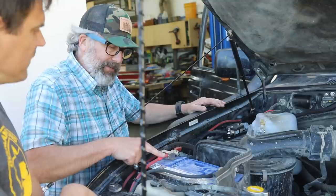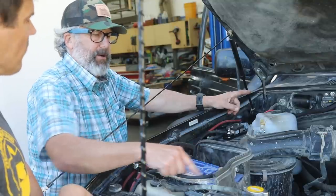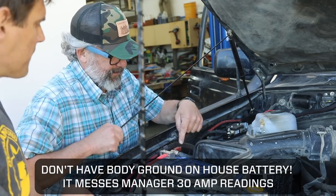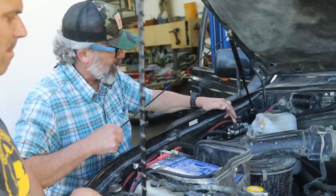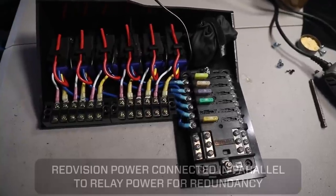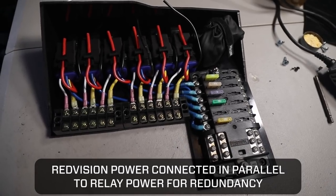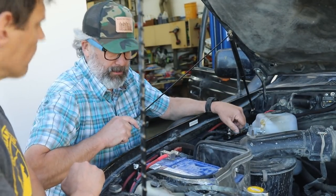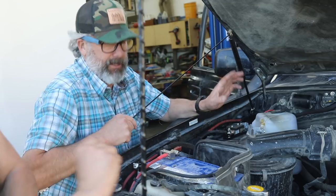So basically, we have a wire that leaves here and goes directly back to the RedArc system underneath the console, and a ground that goes directly from here back to the RedArc system. We also have a chassis ground here — which is overkill. Then we have a sensor wire that senses current flow through the current flow sensor, which is talking to the RedArc system on a CAN bus. Then we have the wire loom that runs all the way around back to the old fuse panel. All the loom and everything under the dash is permanent. You're 100% done — no more things mounted anywhere.